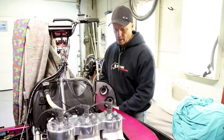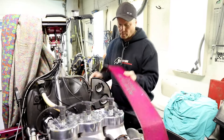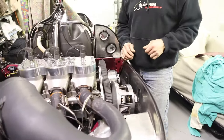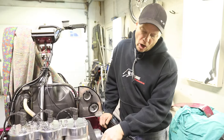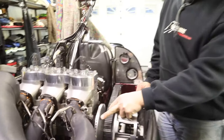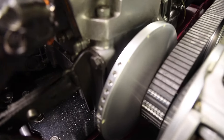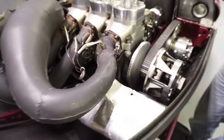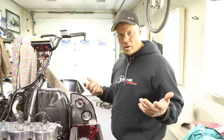I'm going to explain a few things here because I know it can sometimes be confusing. We'll do it on this old girl because it's just a little easier. Now remember in the other videos, I mentioned something about chalking your clutch. This clutch was chalked and I have very little chalk left on this clutch, so my clutch tuning is almost perfect. You don't have to worry about chalk getting on your belt — that's why we use chalk, because it's light, it's got no sticky residue, it's dry.